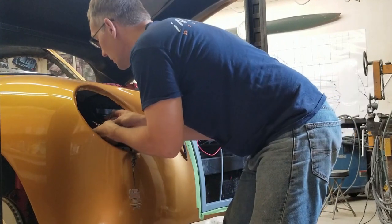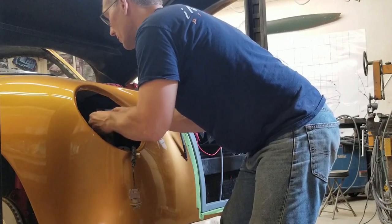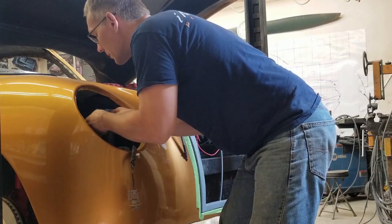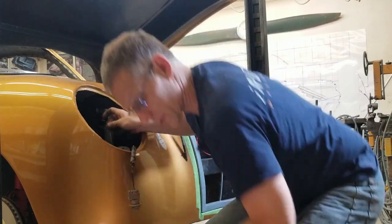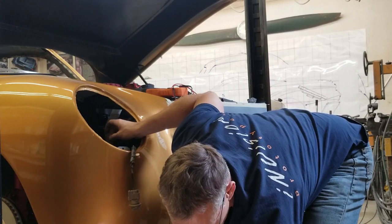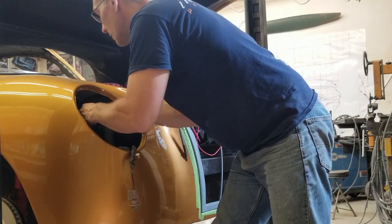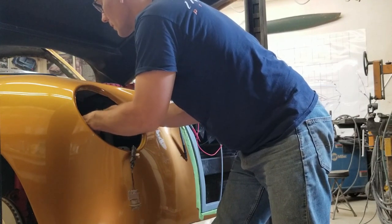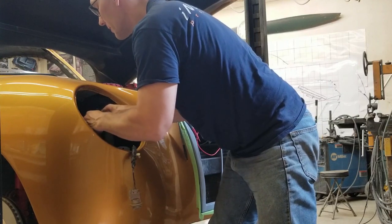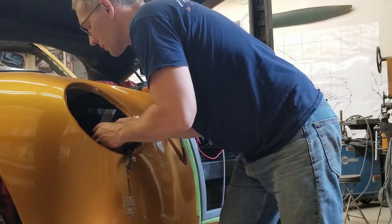We're on the final stretch, guys. The black on the Mustang does mean ground, but on the Mini Cooper, brown is ground. Just double check — I do not want to mix them up, because it will annoy a lot of people when you're coming in a direction with high beams. I wish you guys could see — I'll bring you guys in and show you how the wires are done up. Just let me get this last one done. You always want to solder your joints, otherwise they're going to oxidize and you'll have poor connections, and your lights won't work.